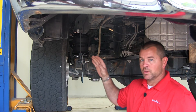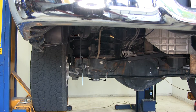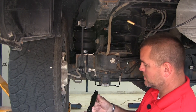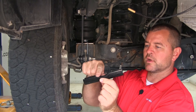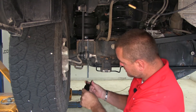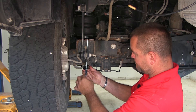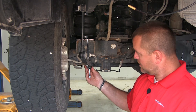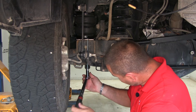Once torqued, lower the axle back down so the bottom plate sits on our bump stop plate, and let it all the way down to normal. Take a large U-shaped bracket — the rounded edge faces up toward the axle. Take the bolts, go through each of the two holes, and put on a flat washer and lock nut on each side. Tighten them evenly so the bracket sits flat against the bottom of the axle. Torque to the specifications in the instructions.